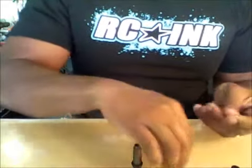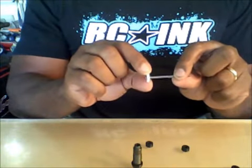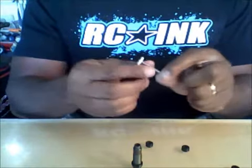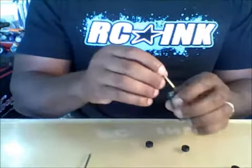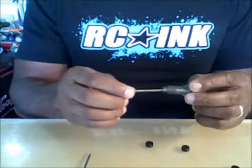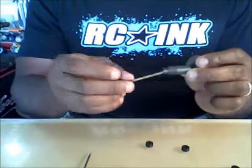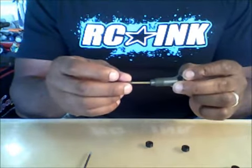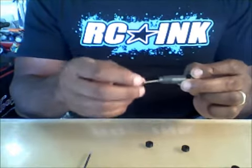Your normal shock piston, on an E-clip style anyway, has not a lot of play, but a little bit of play in there. So in essence, your shaft is floating from the piston and they kind of separate themselves, except for up and down movements. Well, what happens inside the shock, and everybody knows that on a nitride-coated shock shaft, you get a wear spot. This one that I'm holding now has the same wear spot. Well, that's because you get this. You get that because the only contact points are the piston and basically the O-rings that seal the end of the shock body. So you get a lot of that.